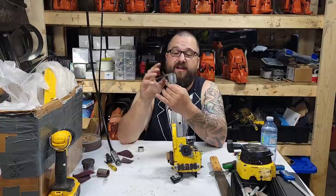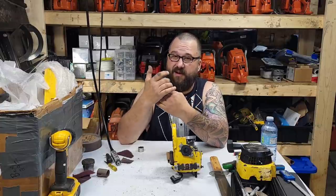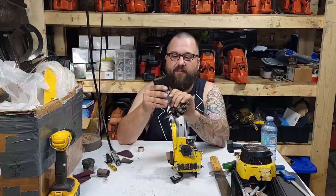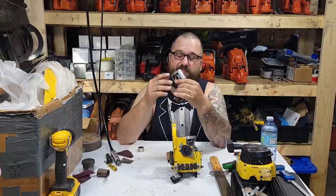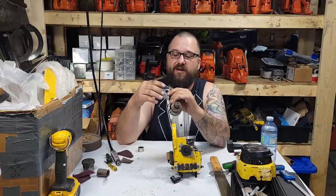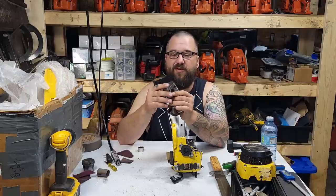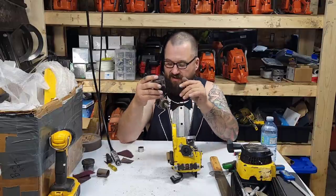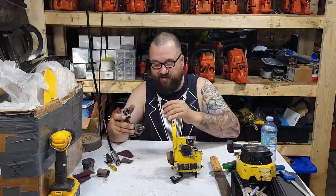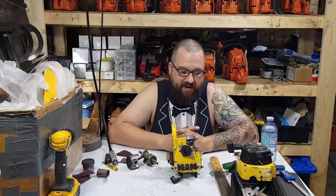Now, I've had two saws in here with a piston that was all gouged like this with no plating failure. Usually a gouge like this, though, is something went through the saw or the plating's coming off. So, the fact that these rings are not cooked at all makes me know that this thing wasn't run too lean. Of course, Buckin was thinking it was something he did, and I was thinking it was something I did. And that's the way it goes sometimes, friends.